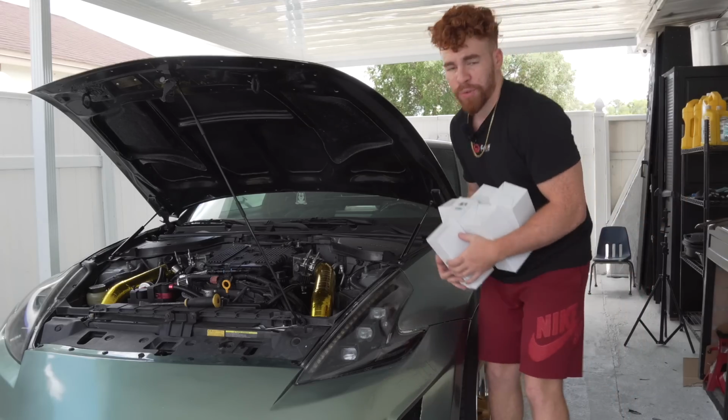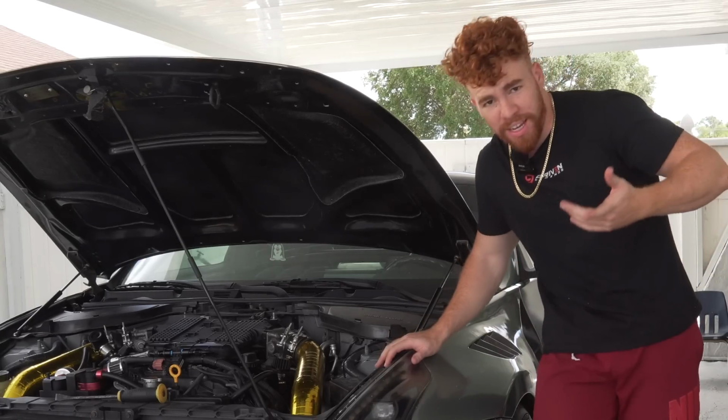Here we got all high frequency coil packs, not sponsored once again. First E85 fill up and I'm praying that the car's not misfiring, that we actually fixed the issue. So the boost should be up by 2 pounds or so. And if there's no misfire, we should be putting down a lot of horsepower.